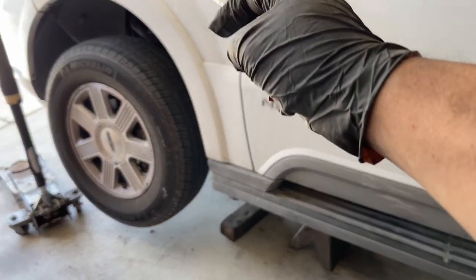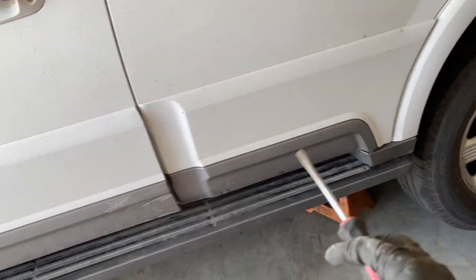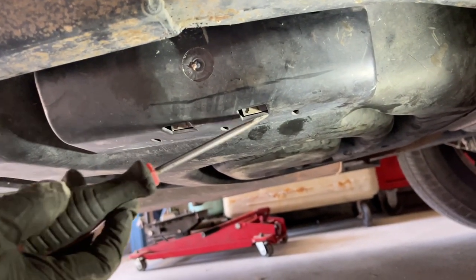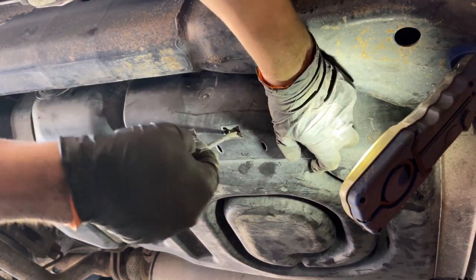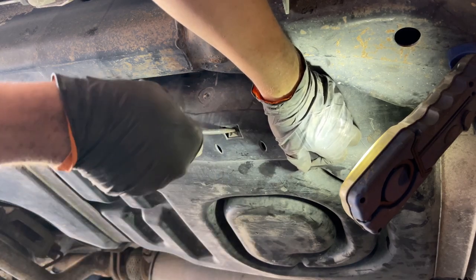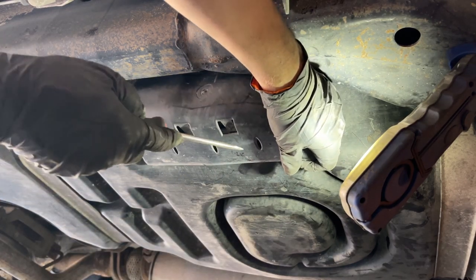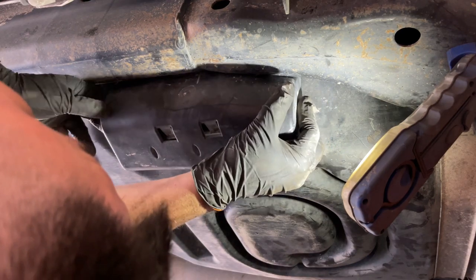The filter itself is going to be behind the rear door. Here is the rear door — right under it we have the fuel tank. That's the middle of the fuel tank, and this little cover right here is where the fuel filter is at. To remove it, I'm going to put a flat head screwdriver in right here and push the tabs upwards so I can get them to unclip and then just pull it out. The tabs on the top are just a little hook, so if you just push the cover up it should come right out.